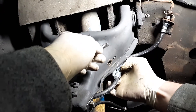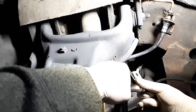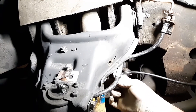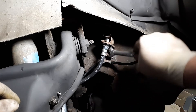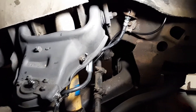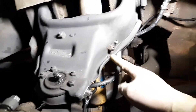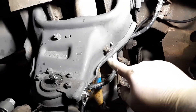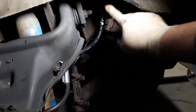Get the brake hose — I've already knocked it in place and it's staying. Now get this bracket behind it and it goes in there. Make sure that everything is tight, snug, and leak-free. Tighten the 13mm nut — there's a nut and a stud on the inside you've got to hold still with a 13mm — you can go underneath to hold it. Tighten the brake line down.